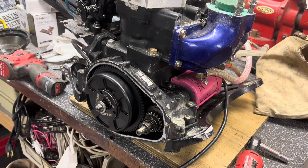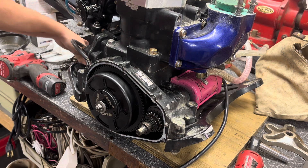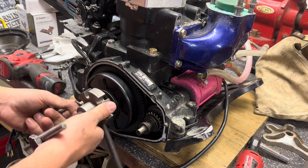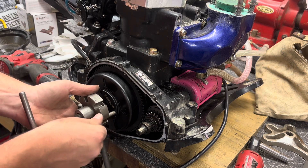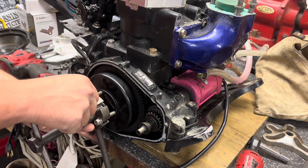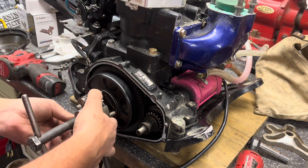I have a custom tool made from a buddy of mine as a flywheel puller — works awesome. But the actual style of a flywheel puller like this works perfectly fine. I have two bolts that I use; you thread them in. You want to get like two or three threads — nothing crazy — because if you go in too far you could hit your stator itself and damage the coils, so your stator would no longer be good. Make sure they're threaded in evenly so that it's pulling flat.